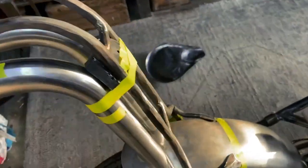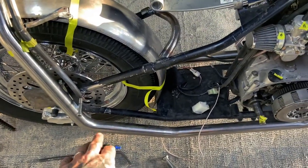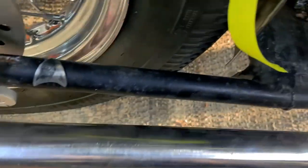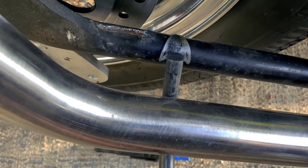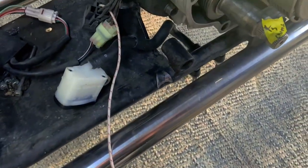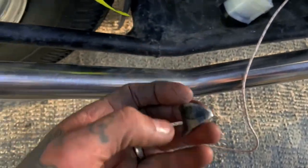The sissy bar is all bent up and I'm just tacking on these brackets now. Then I'm going to move on to doing the exhaust brackets. I've had these little arrowheads laser cut out by a good mate Dave. I've hammered them so they'll fit around the frame, and then we're going to have an exhaust bracket come up and mount on like an arrow. You're going to see these arrowheads dropped along the frame — just something a little bit different to break it up. So on to hammering and bending all the arrowheads to fit the frame, then I'll get everything welded up.